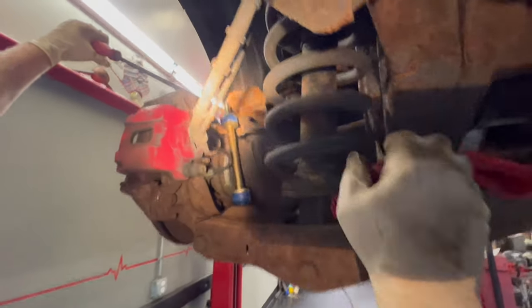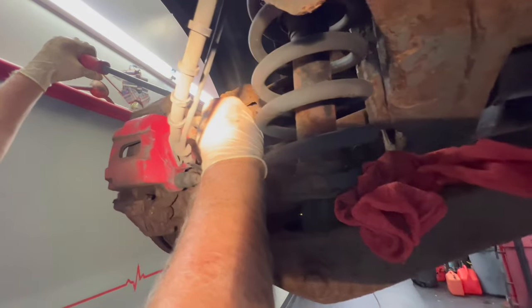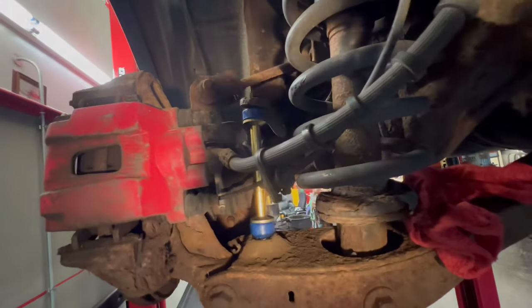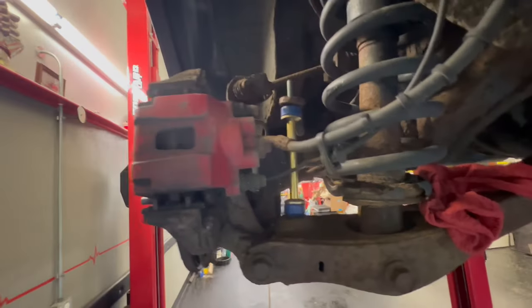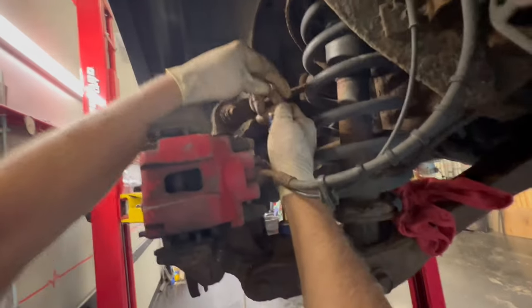All right, so I just got it on my rotor, and I very gently have to pry up. So I'm gonna push down on this threaded rod a little bit here so it's kind of flush, and then get that in there. And now I can push up on the bolt, and it comes up through. Okay. We've got our other grommet going on. These have a tapered edge to them, and you want the tapered edge always going towards your eyelet there. So we got that up enough, and then sometimes you gotta pull down a little bit to get the nut started.